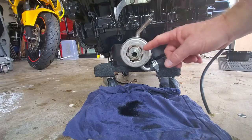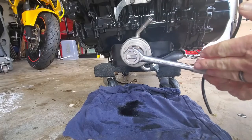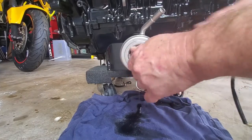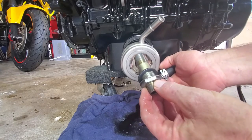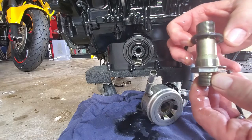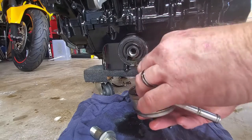This oil cooler is held on by a through bolt here, and this happens to be a 30 millimeter. So I'm going to go ahead and get that on there and try to get this thing off. Just be prepared because there's a washer behind this — that is the bolt that holds it on there, and don't lose this washer. On the back of this oil cooler you can see there's also an o-ring that sits on the back. Don't lose this o-ring.